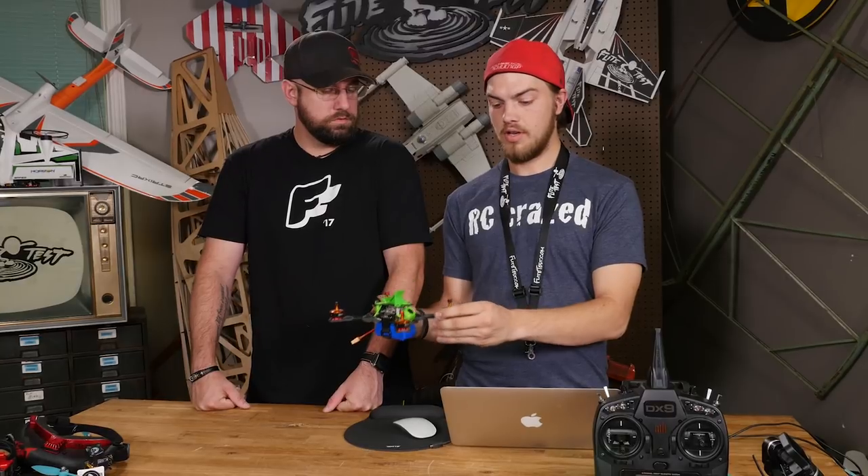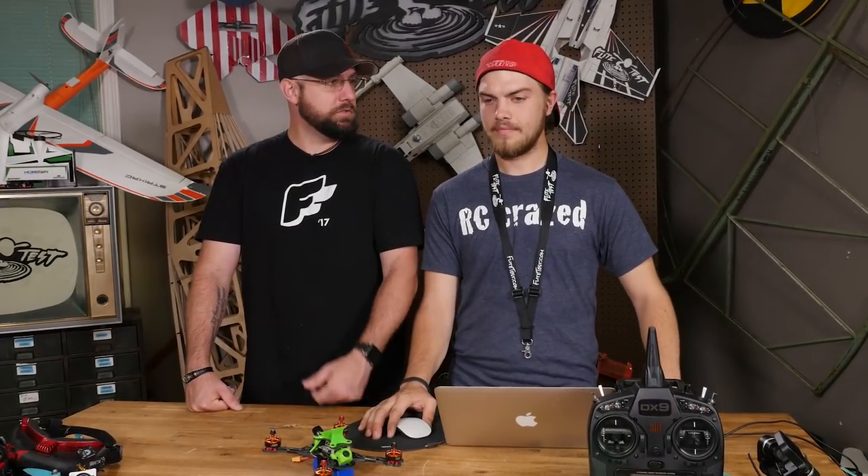In addition to turtle mode flipping you back over, with Release Candidate 5 you can also tone your motors — they'll vibrate and twitch from the ESC as a beeper function, if you don't have a beeper. So they actually make noise. Yep, they'll tone and twitch and be loud enough to hear. It's pretty much like the noises your ESCs make when you start your quad up.